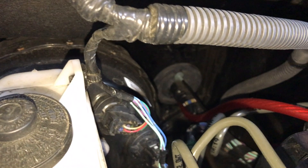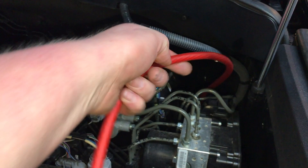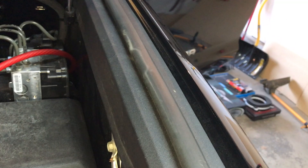We put a little WD-40 on there, and the wire goes right on through and out from right underneath the wiring harness. If you need help, you can use a zip tie or a hanger to tape the wire through and pull it through a little bit easier. We're going to zip tie this up — it came with loom so we'll make sure this wire looks nice and clean. We'll mount our fuse holder on the side of the inner panel and have enough length to go to the positive on the battery.